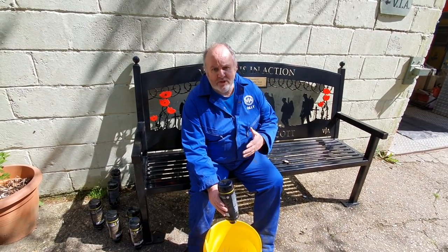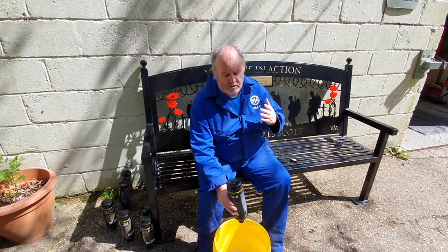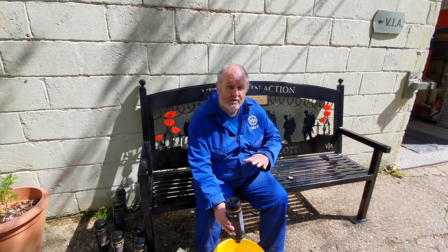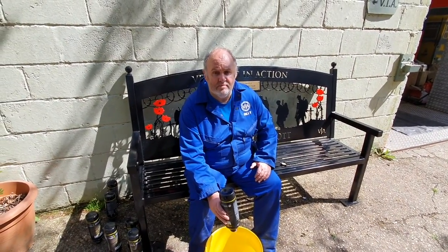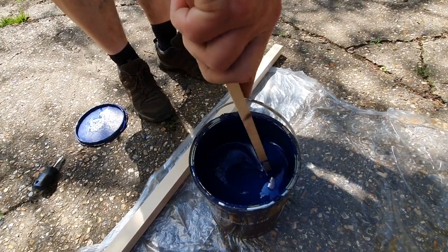Once that's all mixed up so we get an even coat through the vehicles, we'll then decant this back into the bottles, and then we'll add 237 millilitres of hardener to that, which you get that exact amount when you buy a box of 4 of Tintable Raptor. That's the process we're using. As I said, not everybody's going to do this the same way - this is just the way we've chosen to do it. When this batch is gone, we'll let the paint dry and we'll do a second coat by mixing up another batch. This is the Veterans in Action Blue that we've used in all our vehicles - we're going to mix 400 millilitres of this into the Raptor mix.